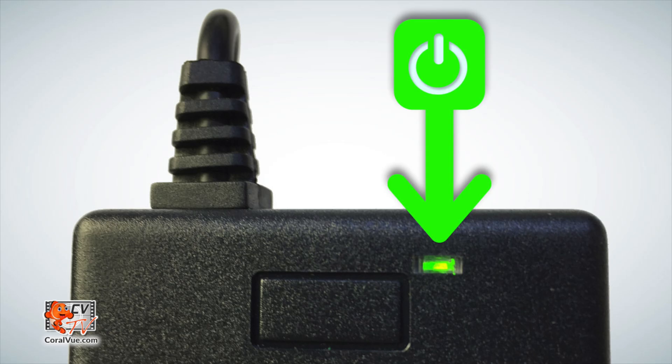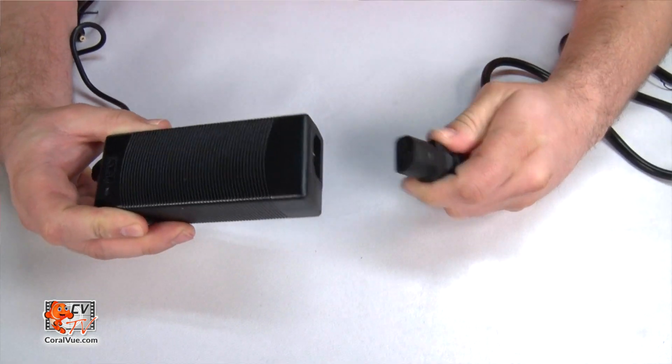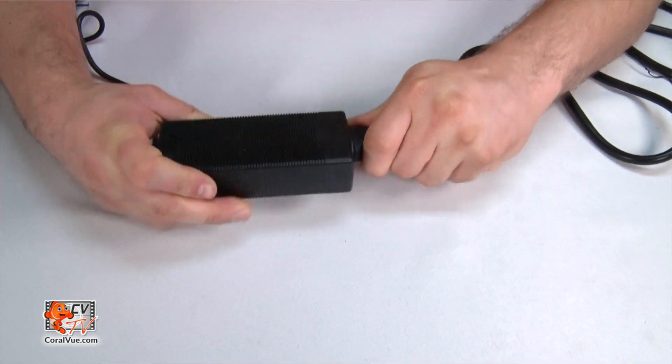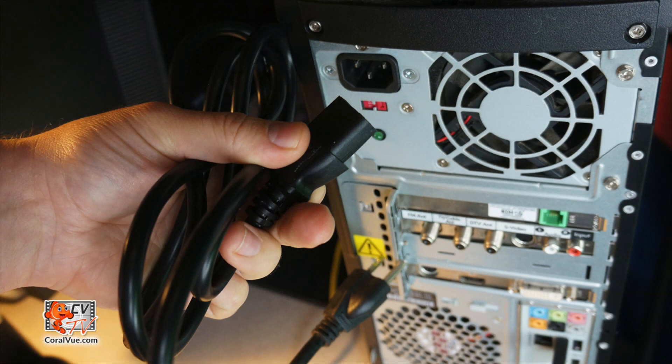If the pump does not work, we need to look into all three of these parts to narrow down the source of the problem. First and foremost, we need to make sure that the light on the power supply is still illuminated and remains in a solid green state when plugged into a live outlet. If not, inspect the power cord to ensure that it is fully inserted into the power brick. Also, make sure that the power socket itself is active. If needed, swap the power cord with one from another appliance to see if the cord itself could be at fault.